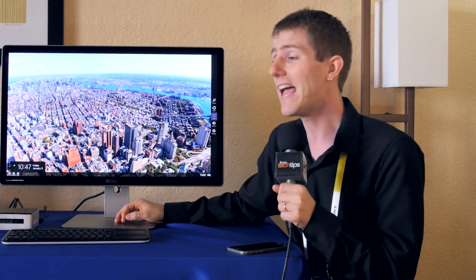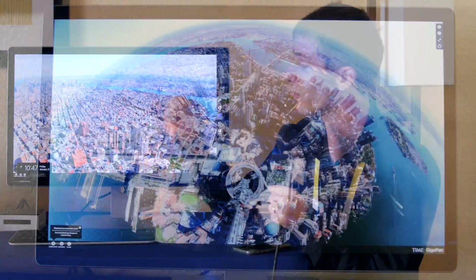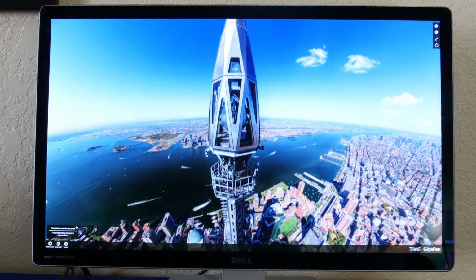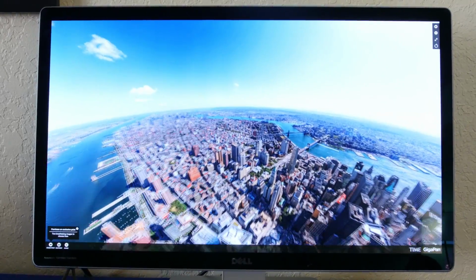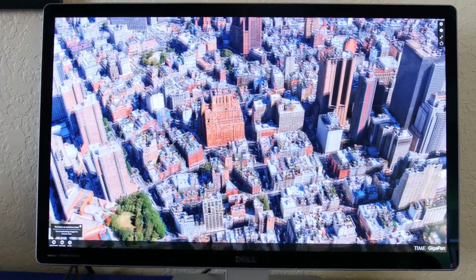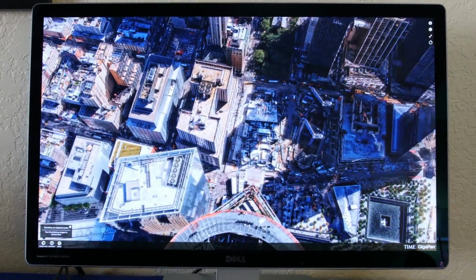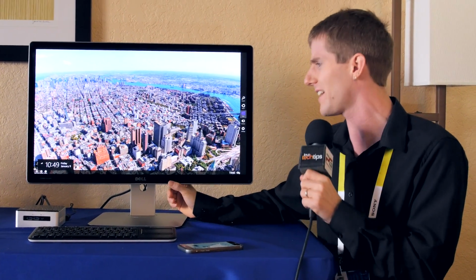Now, this thing is not cheap. It's over $2,000, but at least it comes with the kinds of professional grade quality and features that you'd expect from a monitor of that caliber. So it's an IPS panel. It's got a 10-bit panel, so that's a billion colors, featuring a 12-bit lookup table, so you're going to be able to work with broad gamut content if you want to. It supports 99% of Adobe RGB. It's got support for advanced calibration features with an X-Rite color calibrator, and it even comes with a report in the box certifying its Delta E less than 2 calibration, so you shouldn't even really need to do anything unless you have your own personal needs that are a little different from what you might get out of factory calibration. I'm not really sure how much else there is to say about it, other than that it looks absolutely stunning from the front, from the back.